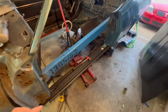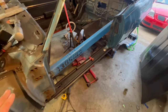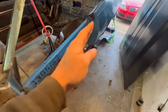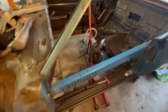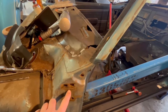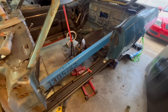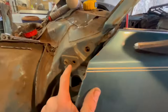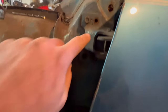The rocker panel is now just sort of tack welded into place — a couple of tacks here in the front, and some vice grips in the back. We're going to put the door back on the car to check the gap across the bottom of the rocker panel and make sure everything lines up with my marks. I'll recheck my measurement from here to here. We did these little eighth-inch pilot holes through the hinge — we're going to line it up exactly as it was before I took it off. TV magic — door is installed. We used our little eighth-inch pilot holes we drilled before taking it apart. Stab your drill bit through and snug these hinges up.